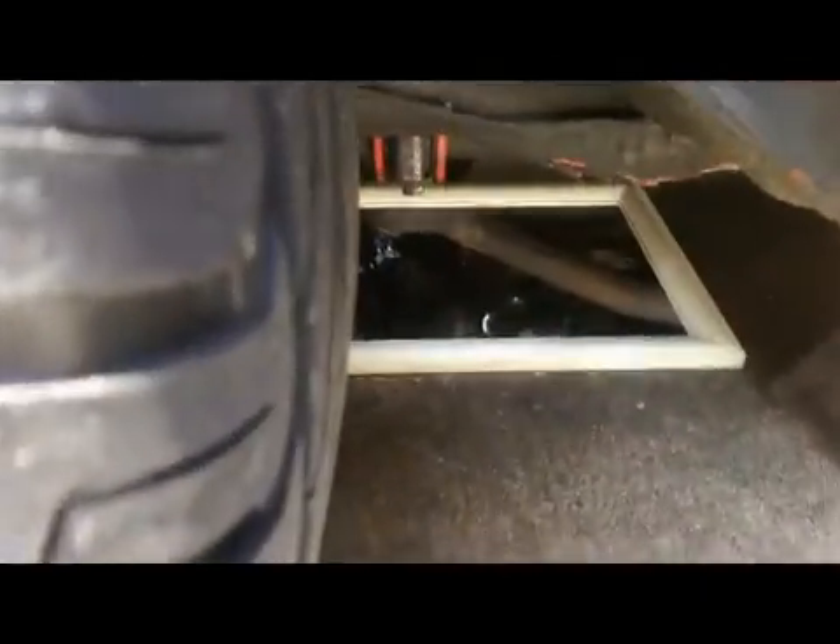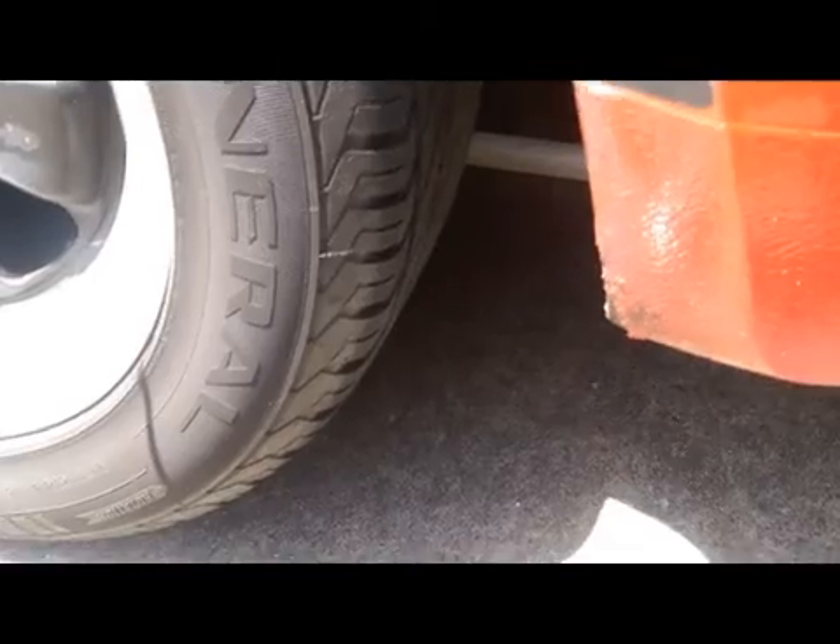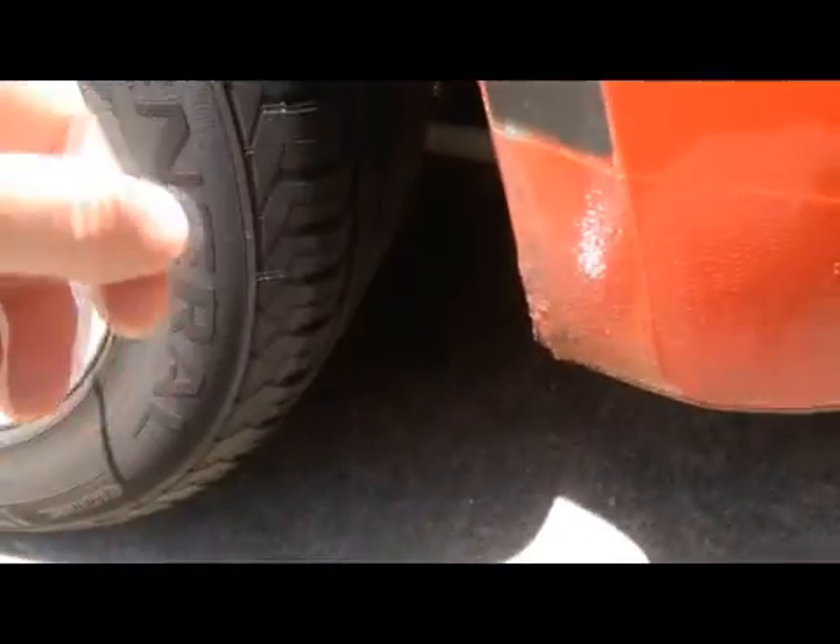The reason this is all down here is because I'm a lazy guy. I've got a mirror propped up by a few bricks. There's a timing mark on the bottom of the bell housing and a little window for it, which I think is a lot easier than trying to read the silly OT mark up here. Mine is barely legible, so I thought I'd jack the car up and put a mirror under there and just point the timing light at it. Of course it'll be mirrored, so instead of going up I'll actually be going down the timing, just from looking at it anyway. That's the setup.